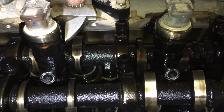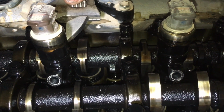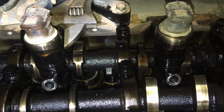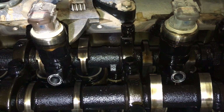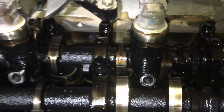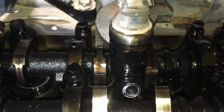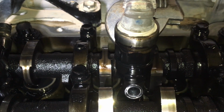I knew this would have blow-by. You can't have an 08 with almost 230,000 Ks without having it, because it's just based on averages. This is what I say. I know these engines, I know these injectors, I know these cars, and that one sounds like it's got a bit more grit on it. All right, hear that, guys? Hear the first one, have a listen to the difference. Right, that's just started blow-by. There's probably no oil down to the bottom of the injector, mate.